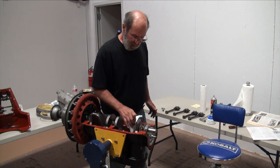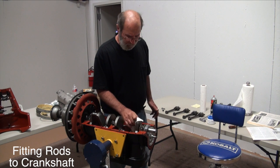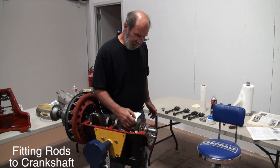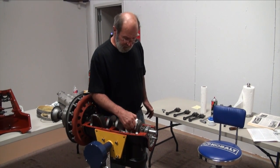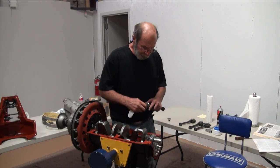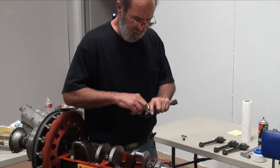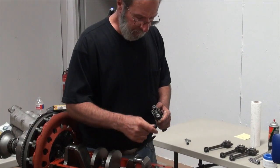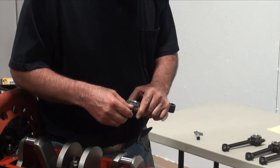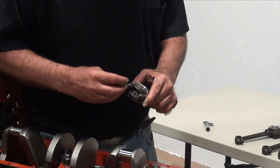Make sure that we like how our rods fit. Remember we had to clean them up a little bit — we drilled a hole in it, we kind of relieved it the best we could, but there's still some slight imperfections on the edges. What I like to do — your mileage may vary — but I just clean off the journal that I'm going to place the rod on. This is the number one rod, and I'm going to set it up dry.